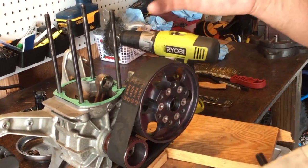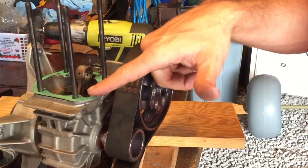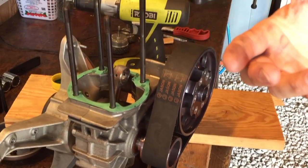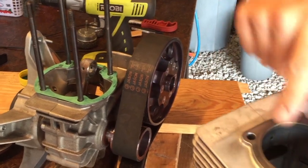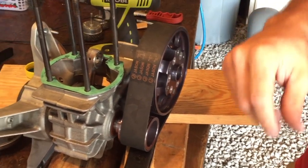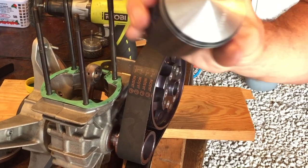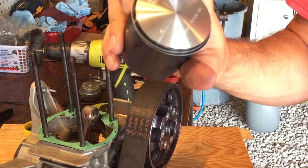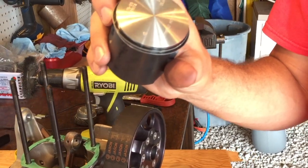When you put this back together, obviously, again, make sure it's cleaned. You want to lube the base gasket with your AMS oil or whatever two-stroke oil you're using. You're also going to lightly lube the sleeve and lube the piston. We just put the piston back together. If any of you guys aren't familiar, the pistons all have A, B, or C ratings on them, and they all have an arrow. That arrow points to the exhaust side of the engine.